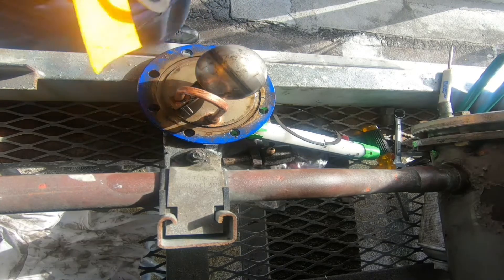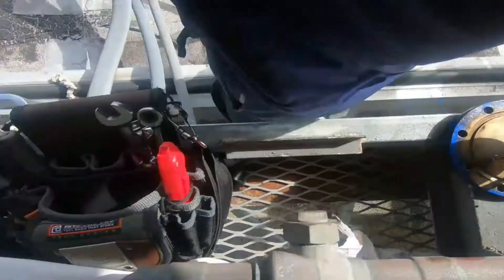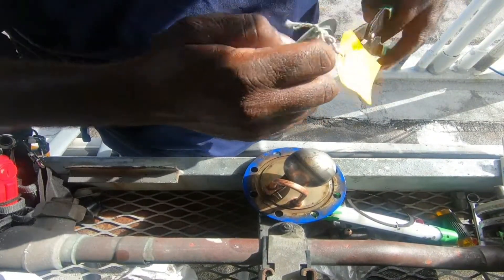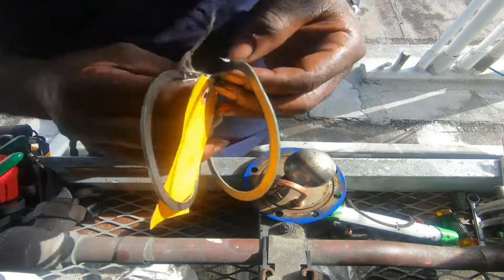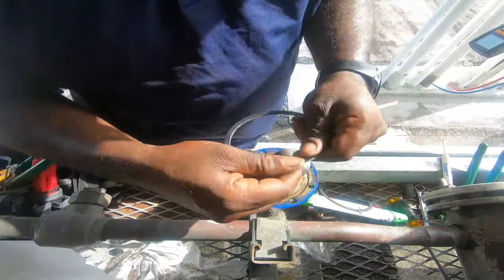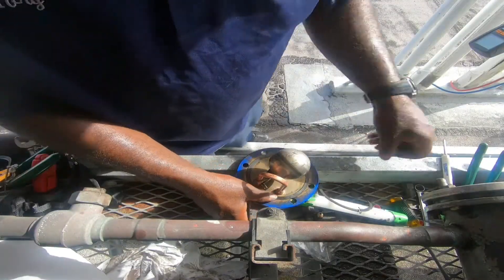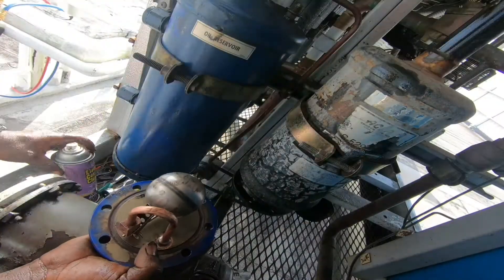I got some new gaskets here. I'm going to go ahead and cut this little rope. What I needed from my tool bag is a knife - I actually have a new Veto bag right here, a little small one. I upgraded to a new bag. You want to wet this up with some oil, put this on oil-soaked, and just kind of put that in there - make sure it's sitting flush, otherwise it will leak. Go ahead and put the float back.